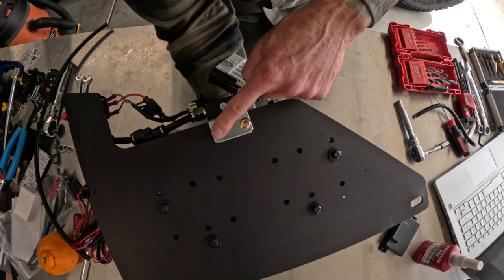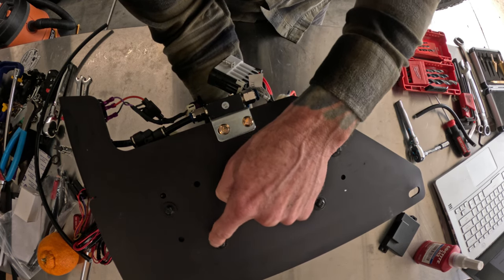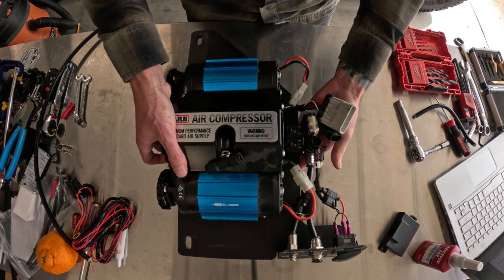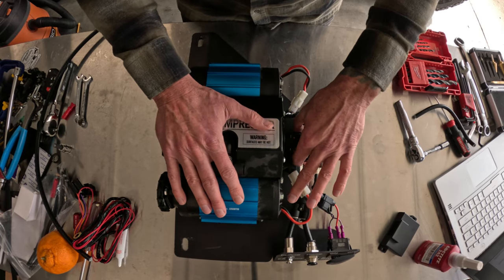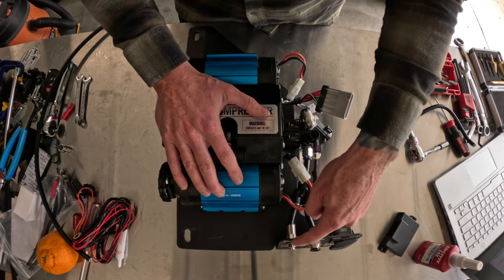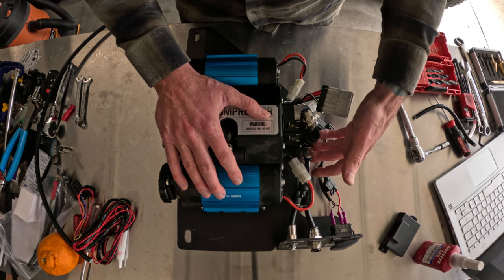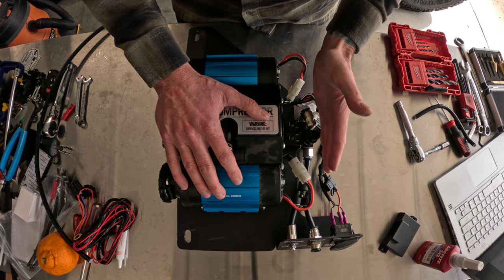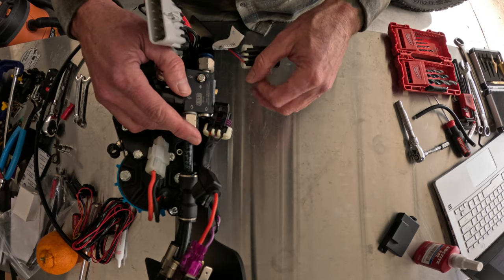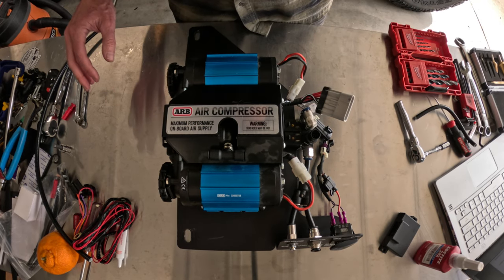Let's take a look at the finished product on the main bracket. Even though this is an old bracket, I went ahead and hard-mounted the system — moved three-quarters of an inch from the existing holes for a new set of holes. Now we have a completely hard-mounted system: compressors mounted, new control system and manifold mounted, all routed back to the original locations. With the modifications to the wiring harness under the seat — shifting everything forward about half an inch — I've given myself enough room for the wires to sit just under the seat.